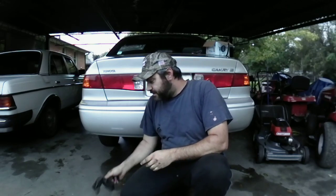This helps me pass the emission test, so I'll be good as gold there. Like I said, my 30-day thing to drive around ran out. I'll see if I can drive it Monday to emissions to see if it passes. I hope it does. Then after that, I've got to replace the valve cover gasket and fix that leak, because I think that's where all my issue is, what you saw underneath the car.